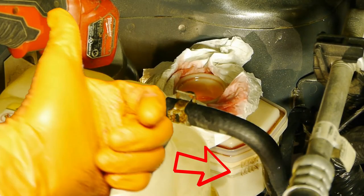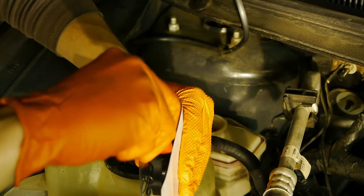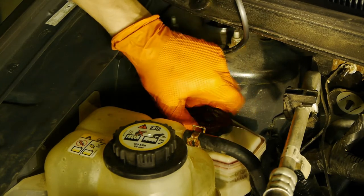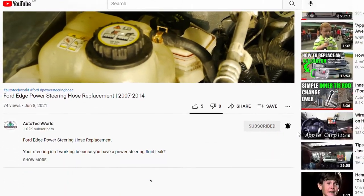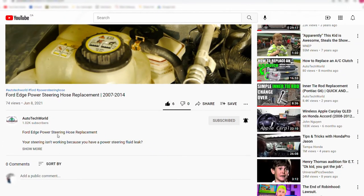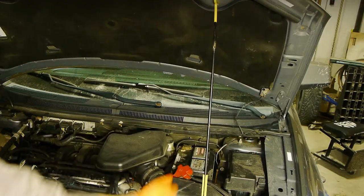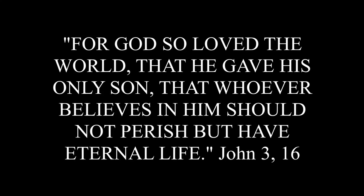Recheck your fluid — looks good. Let's open this package and see if this cap fits. Nice, it's perfect. If you're looking to get any parts or tools that I'm using in this video, look for links in the description. Let's get back under it and see if anything is leaking, especially the banjo bolts. It looks good at the pump and the steering rack. This means the job is complete. If this was helpful, like the video and don't forget to subscribe. You can also follow me on Instagram.